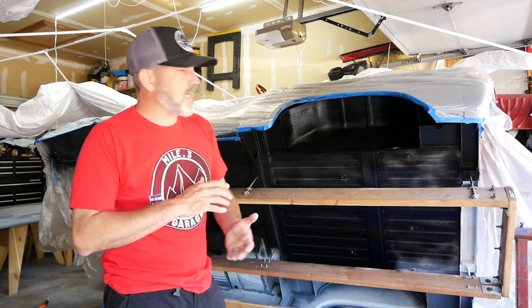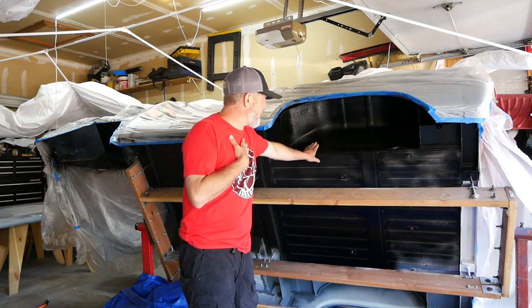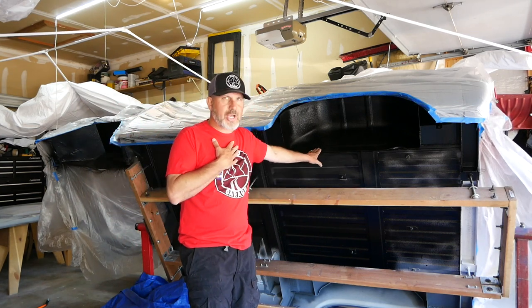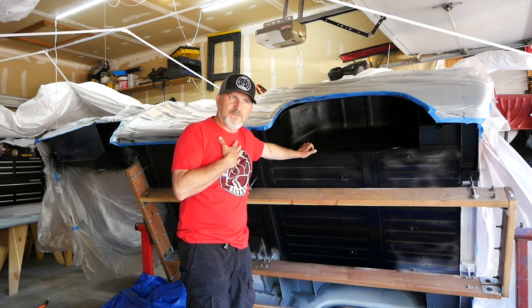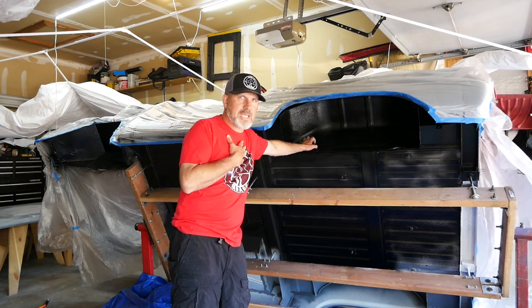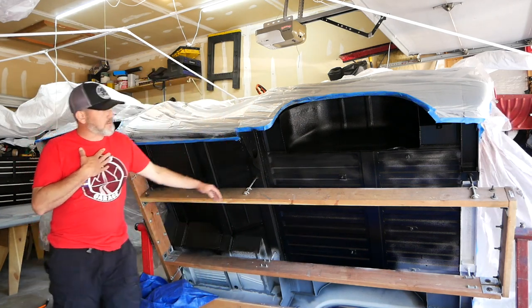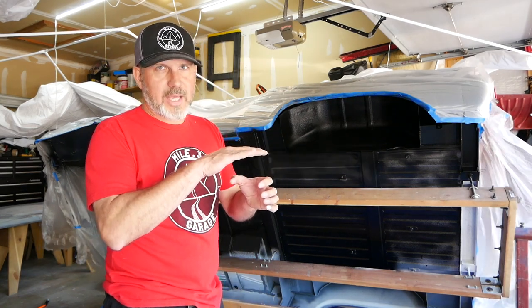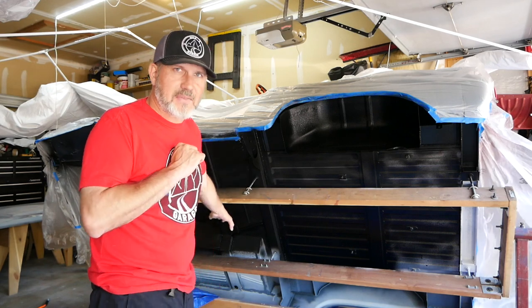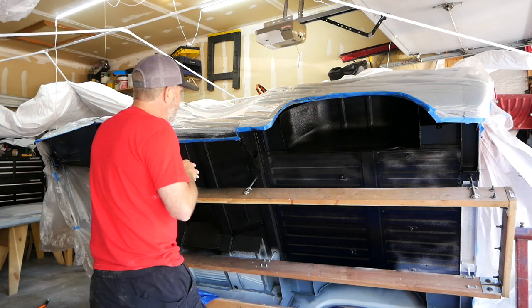And then I sprayed it, and actually that, which is what this is right here, for me, was the best. So basically it's a thinner coat. It was easier to cover without making it too thick, but it still has a very good texture. In fact, I think this texture right here is more even than the texture in the front. So that's the way I'm going to finish out the rest of this. Hardener to the ring and then reducer to the lip. I'm going to do the rest of this like that just to make it even, and I bet we get the coverage that we want.